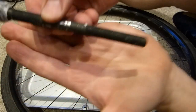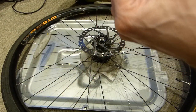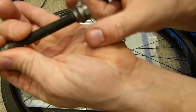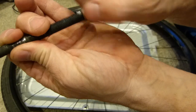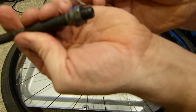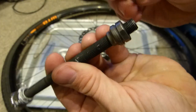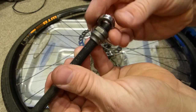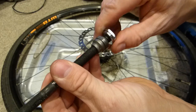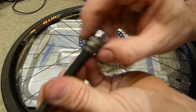This is how the axle looks after it's been taken out. This is the cone, this is the counter nut on it, and there's a thin washer between them. We've got on the axle a cone that just spins on. That design isn't any different from something from the 1950s — could be as far back as 1905. The advance that's been made since the 1920s is in materials, especially metal alloys. So that's how these components go together.